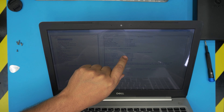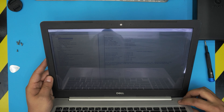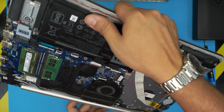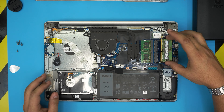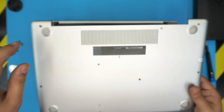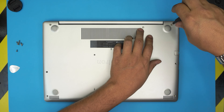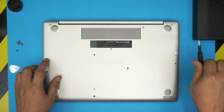To install RAM, make sure the notch on the RAM matches the notch on the DIMM slot. If you try to put it in the wrong way, it won't go in. Insert it at a 45-degree angle toward the slot and push it all the way in until it clicks. Then push it flat toward the motherboard — you'll hear two clicks, and the retaining clips will be straight, meaning the RAM is in place. Repeat the same process for the second RAM stick: match the notch, insert at 45 degrees, push it down to click.